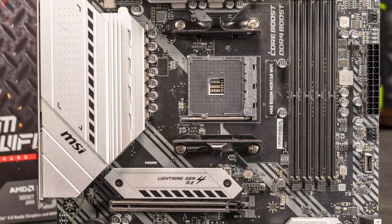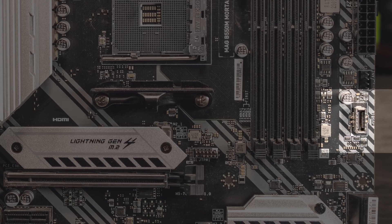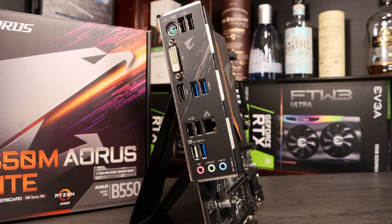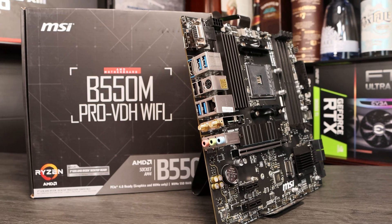One of the main areas where features vary on B550 motherboards is USB connectivity. First of all there's the USB 3.2 Gen 2 header — not all motherboards have this. It's an internal header that connects to the front panel on your case. If you choose a motherboard without this header and a case that does have those sockets, you'll have dead sockets on the front of your case, which can be very frustrating. Secondly take a look at the rear I/O panel — some motherboards have quite restricted USB connectivity, so make sure they're sufficient for your needs and any future requirements.